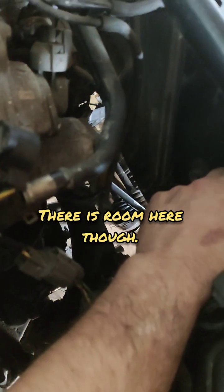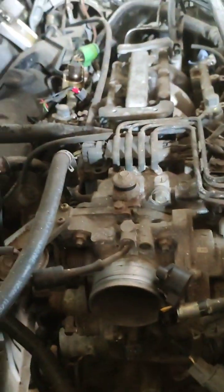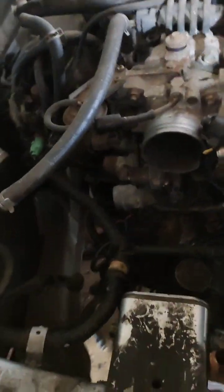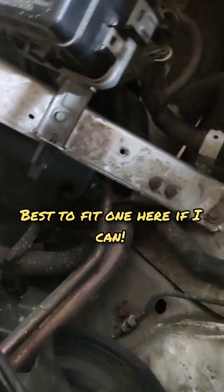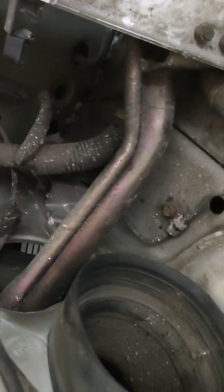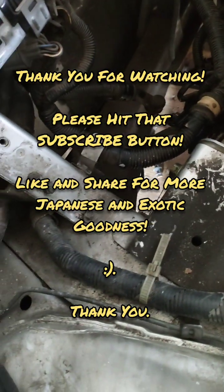What have I got behind here? Not much — it's pretty empty. There's a little brace going from there to there, but I could fit two intercooler pipes out of here. One would come round and go straight into there; one would go into the supercharger. That might be an option. Or there is this space here which is looking fairly big. The only problem with putting it there is the airflow. I've got airflow here, and obviously from the vent there — possible airflow if I open that up. I could open that up and make more airflow. Might put one in here, but the fuel lines are here — might be a bit of a tight squeeze.